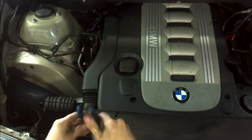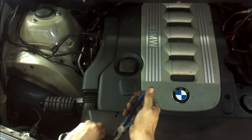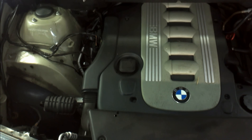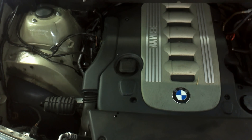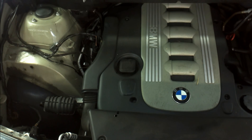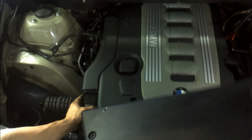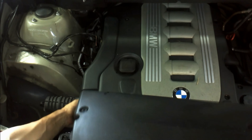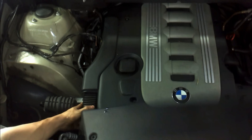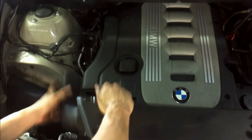Next job, we're going to take out the air intake — the plastic intake at the front of the car here. Using a pair of pliers, pull out the centre of the little black plastic plugs, four of them. Then you can get the large trim out. It's connected to the intake where my left hand is now — it's a little catch. Just work that catch off. You could probably get a little flathead in there, but you can work it out with your hands.